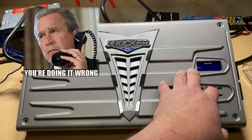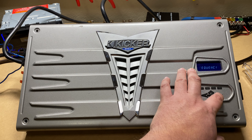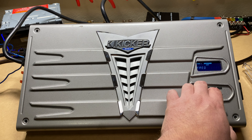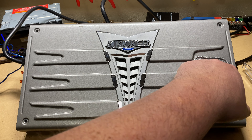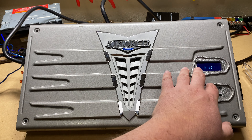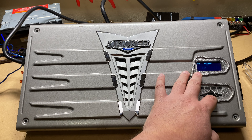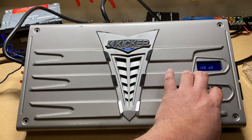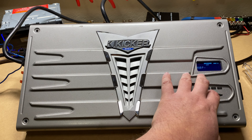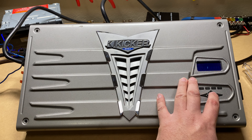You can adjust the phase - that's cool if you don't want to go through and hook your speakers up opposite ways. You've got a high pass and a low pass crossover you can choose here, and you can do either amp independently. For amp one you can set your frequency and set the slope. Your high pass filter is right now set on 84 Hz. You can come in here and set a 24 dB slope, and you can change that to 12, 18, or as low as 6. You can turn the slope completely off, and options go 6, 12, 18, 24, 30, 36. And again you can change the frequency and do this for each amp.